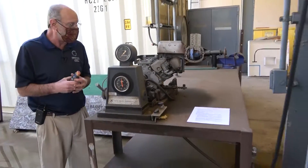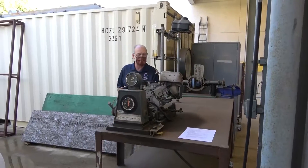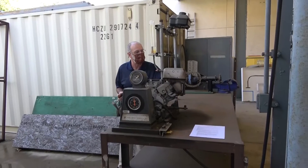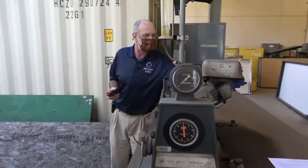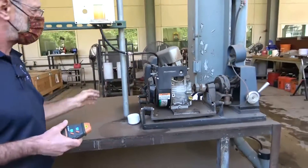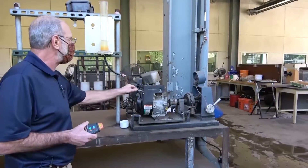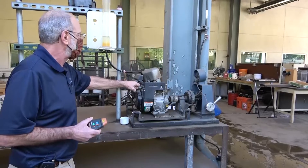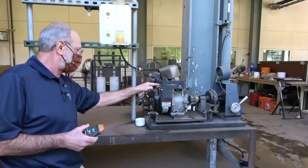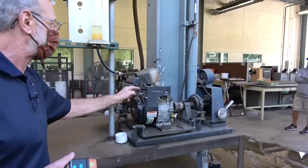We're more or less ready to start running. To start it up, I'll make sure the choke is on — there's a choke switch, we'll move it to on. Sometimes with the choke on the engine sputters, so I may have to turn the choke off. Then we also have the throttle, which is manual — we'll move it towards the rabbit. There's a little icon of a turtle and a rabbit, or a tortoise and a hare. Tortoise means minimal throttle; hare means maximum throttle.